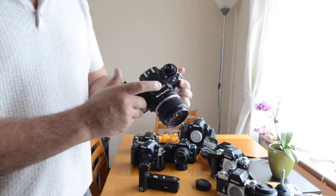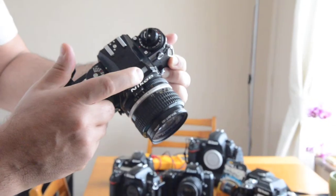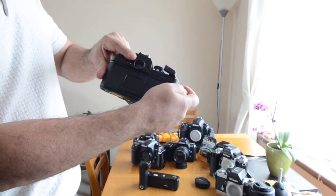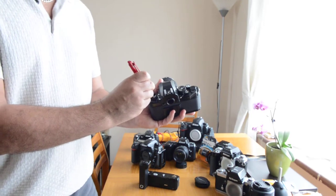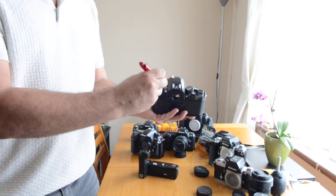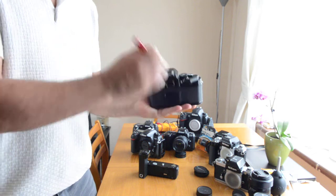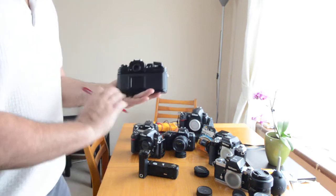This is the shutter speed indication illumination window. If you see C250 that means it's not right yet. Once you see the shutter speed, you're good. But after you crank it three times, you've got to remember to pull the negative back — by rewinding this. It just tightens it up so it's nice and taut, so you get a nice clean image in each frame.